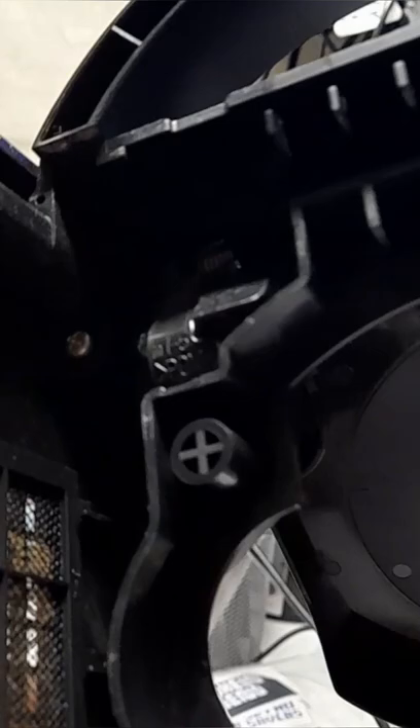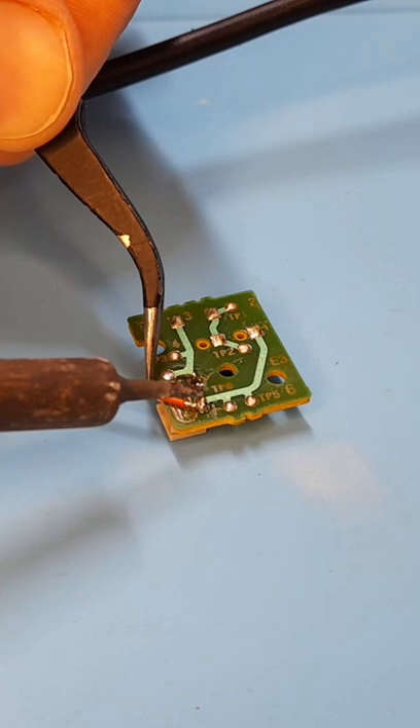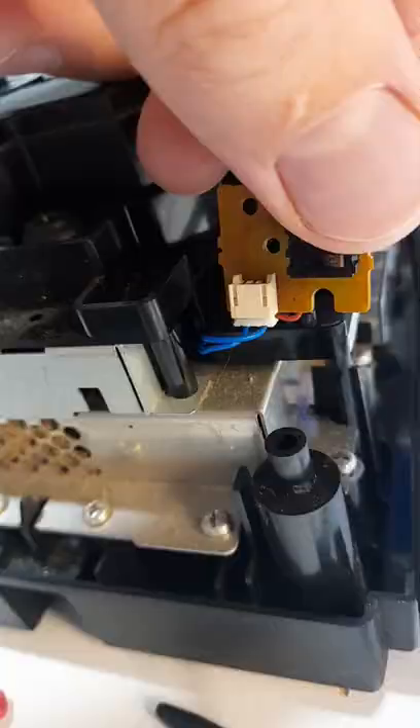To open the lid, this little lever shoots down, and it relieves pressure off the little switch that should be here, but it's gone. So we're just gonna bypass the switch. This will basically trick the system into thinking that the switch is being pressed. The only issue is that if the lid is open, it will still read it as closed, and that could pose a hazard with laser beams and all that. So, pro tip, if the system's running, don't open the lid.